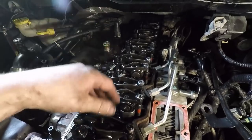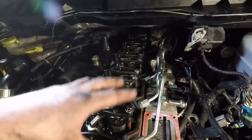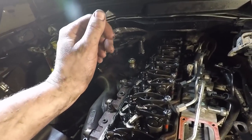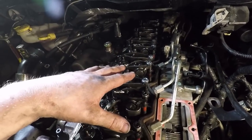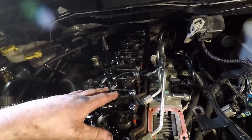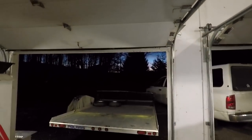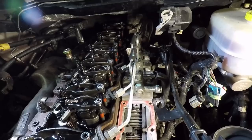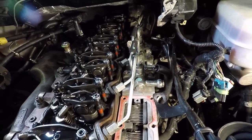With these lines you just want to crack one side and then crack the other — get rid of number one, get rid of number two, so on and so forth. The back ones are the pain in the ass, as with everything on this. Cylinders one through four up front — that's easy, that's cake. Then we'll get to taking our rockers out, our push rods, our valve bridges, and then the injectors. We're making pretty good time. It's pretty dark, but we're looking good so far. I probably shouldn't have said that because I just jinxed myself, but it is what it is — let's keep moving.